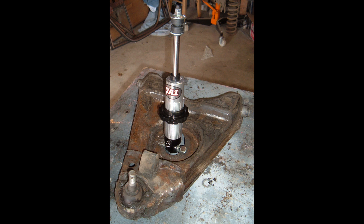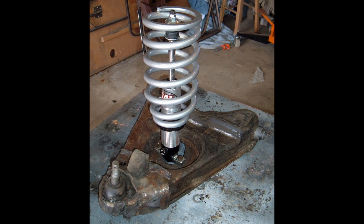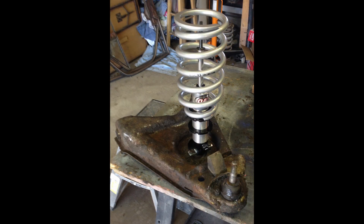This was the beginning of my fabrication work. I mocked up the shock on the lower control arm and added the spring to make sure there were no obvious fitment issues. The biggest concern is we are now putting the entire weight of the vehicle on two little bolt holes on the lower control arm — this is not what Ford intended. Ford created that pocket in the lower control arm so the weight could be dispersed over a large area. Running it as mocked up, I had no doubt that over time we'd have fatigue at that opening and the lower control arm would probably break. Technically you could bolt this GM kit directly into your Galaxy with no modification, but I do not recommend that at all.